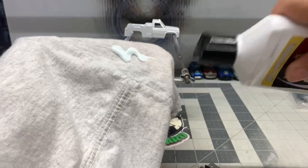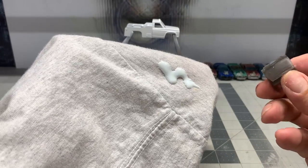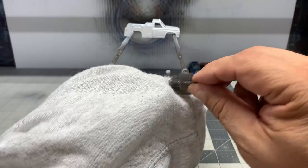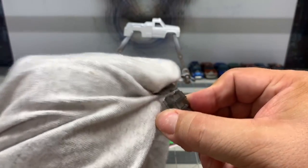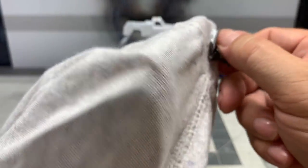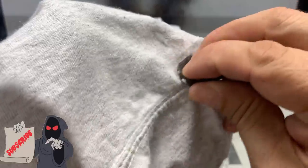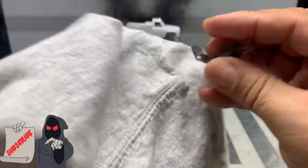Time to work on the windshield. I took some sandpaper to the front of the windshield and smoothed it down quite a bit. Now we're going to take some Meguiar's plastic polish and polish that up by hand. If you try to buff it out with a buffing wheel, sometimes it tends to get too hot and melt unless you keep the RPMs on your Dremel very low. Polish it up as best you can and then we'll hit it with the gauzy.